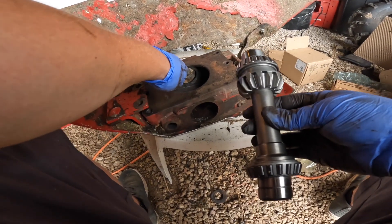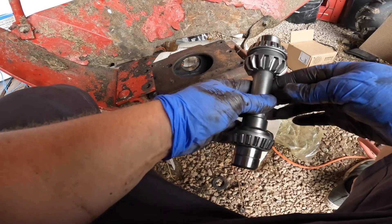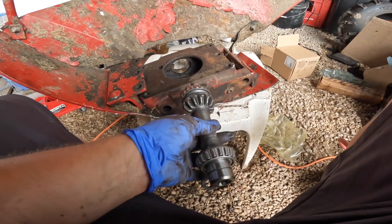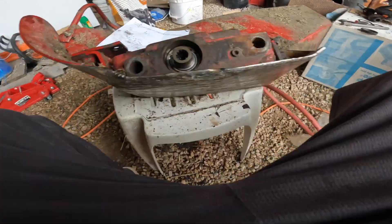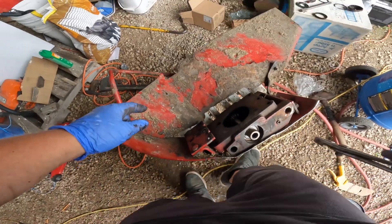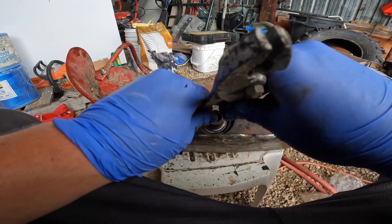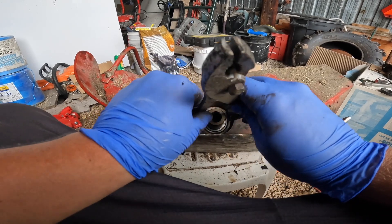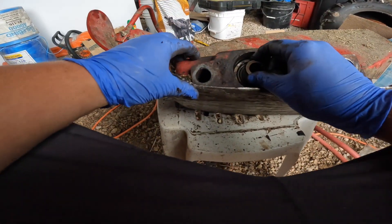Now I'm going to put the pinion in. I got the bearing assembly in there with the snap collar, so I should be able to put this in — and then there's a collar and an end that's going to go on this. I got the other bearing assembly in so it can be held in place first. For this bearing assembly, what I found in the past — take a pair of pliers on each side. Once it gets further in, just gently hold it, tap it, and the bearing assembly slid right in there, nice and snug, no play.